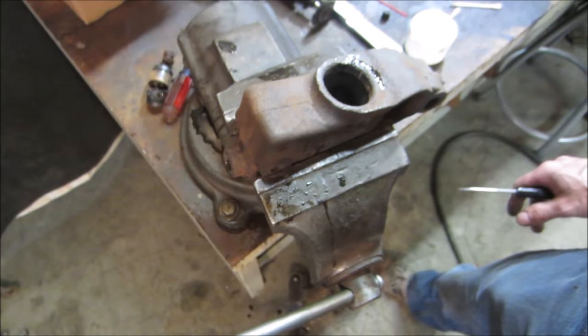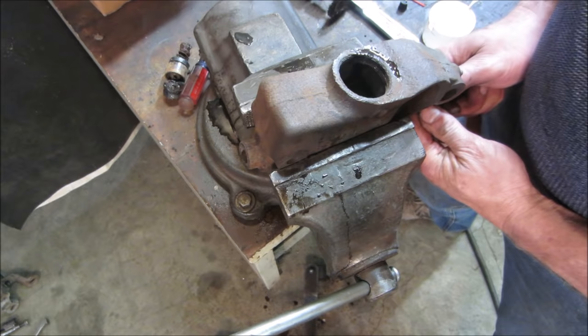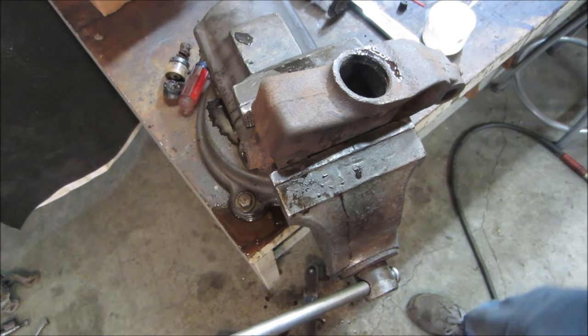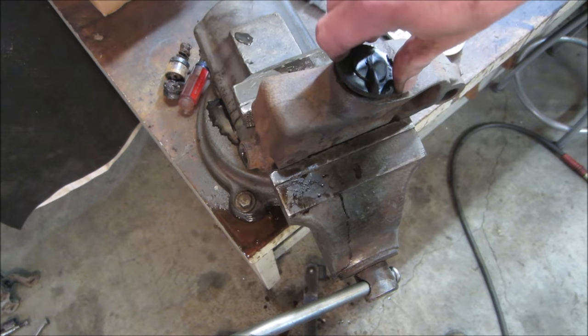Good. It used to roll up before I filled up the chamber behind it. Let's give it a little more. It should start coming out the front. There you go. Purged. That's one thing. I think we're able to bring that back for no money. Now we still have to go deal with those wheel cylinders though.